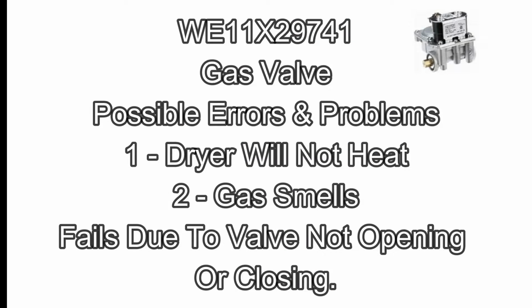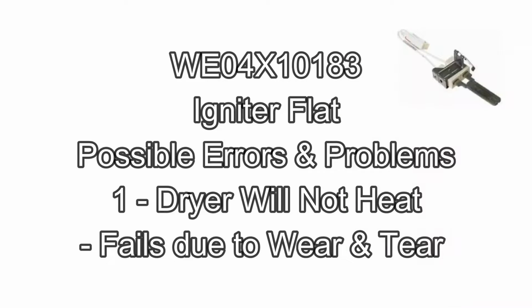This is a gas valve assembly. If you have a bad gas valve, usually you smell a slight gas, or the dryer doesn't heat that well at all. And next we have the igniter here. If this thing is bad, it will basically not heat at all. So you will hear the board click, which sends power to it, but we'll show you how to test that next.